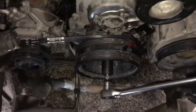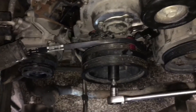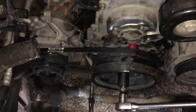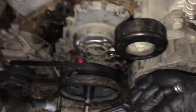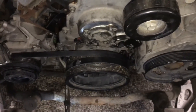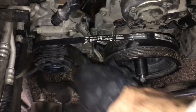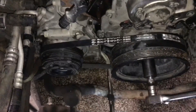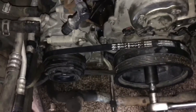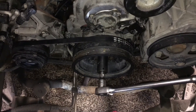Keep in mind that with this motor I'm turning it counter-clockwise. With some engines you actually don't want to turn the crank counter-clockwise because you could cause damage and mess up the timing — but because this is a chain-driven engine it's okay, so that's something to remember. If your tool falls off, that's basically the gist of it. If you don't quite get the pulley and the belt lined up where it's supposed to be, you can just guide it and pull on it like this while you turn. It should slowly come around to where it needs to be. Other than that, I hope you guys enjoyed the video — thanks for watching.